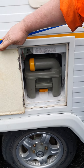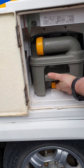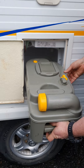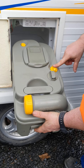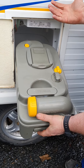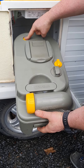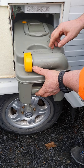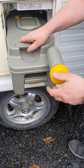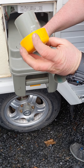Directly underneath is your waste cassette. To remove it, there's a little lever there — lift that up and it slides out. That button, this slider, and this one here are pretty much operated from inside the van, so you don't have to worry about those. This one is just a little air release, so you can press that if it's hard to get the cap off. The spout turns around and your cap will come off like that. You will see there are little measurements on there.